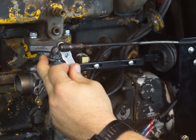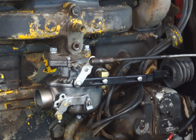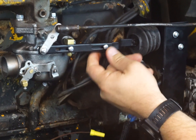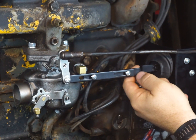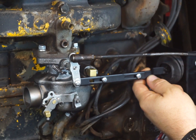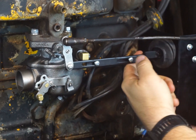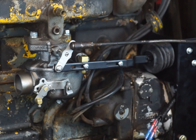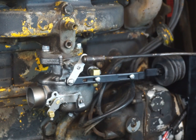When you let go, it just bounces right back. Basically the way this system works: it's a glorified magnet. It has a PC board that controls it — puts power and ground to the solenoid, coming all the way from the PC board and your starter throughout the system, and it pulls the plunger in with magnetized power. When you strike an arc, it senses it at the front. The governor is constantly fighting against your low idle solenoid, so it doesn't push anything out — it just pulls in. When it releases, the PC board drops the ground and the governor pulls it to your operating speed: 1550 RPM on a black face, 1450 on a red face, and 1400 on a short hood.